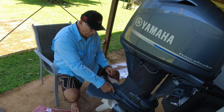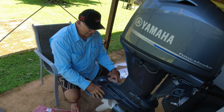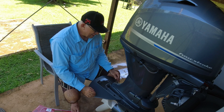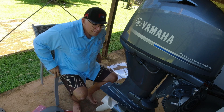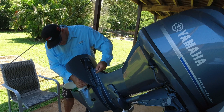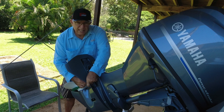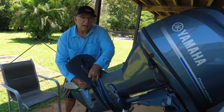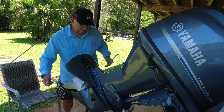What I always do is only drill three holes, and I make sure the last one I drill is after I've bolted the other three in. I've found in the past when I drill four holes, if I'm out just that little bit it makes it a little bit hard to get these things on. So from past experience, three holes is good. It's just a case of pinching it all up and going crossways so it stays nice and straight. It went on really, really easy.